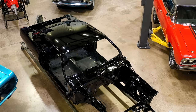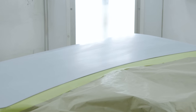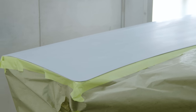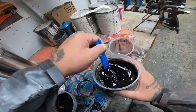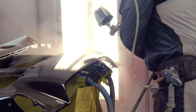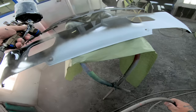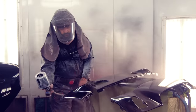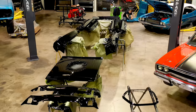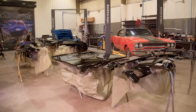With this particular car, we did it a little differently. I shot the body first, completely separate — that way I could get it in, get it out, get it buffed, and get it over to Justin's area. While Noah was doing that, I was able to grab the hood, fenders, all the parts and pieces, and do the final paint on them. Because it is a black single stage, I don't have to worry about color matching at all — it all comes out of one can. You want to give it maybe 20 minutes between each of the four coats. Let the car tell you how much time it needs. After that, I kick it to Noah for cut and buff.